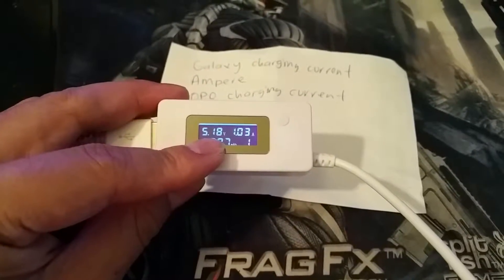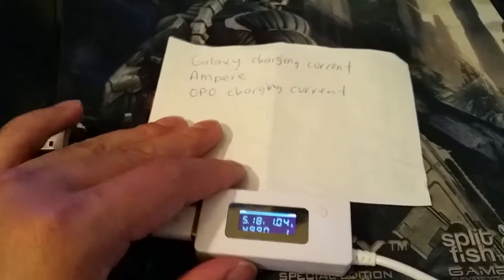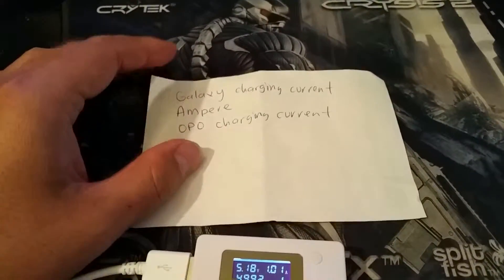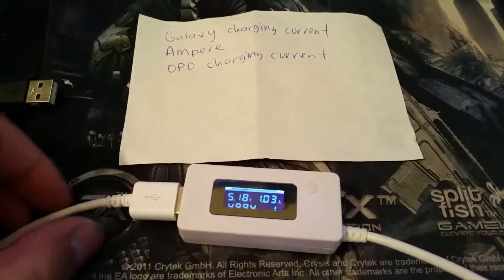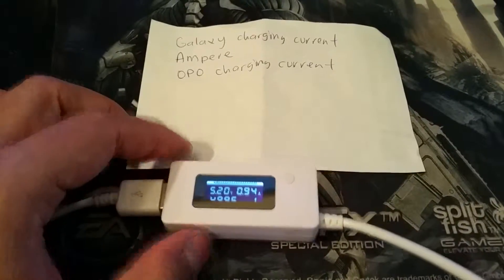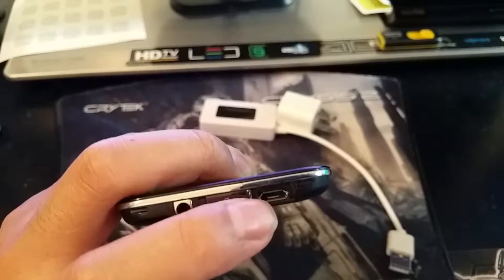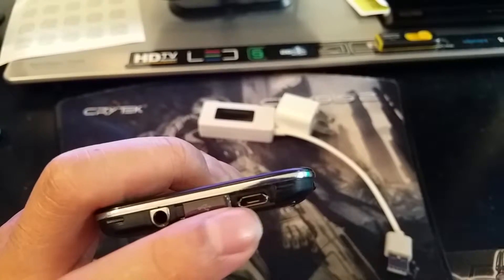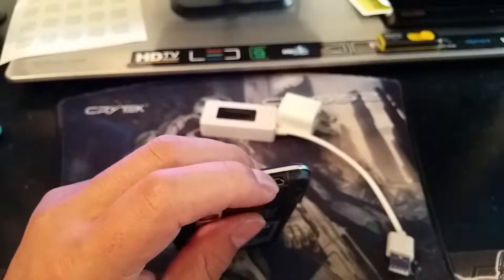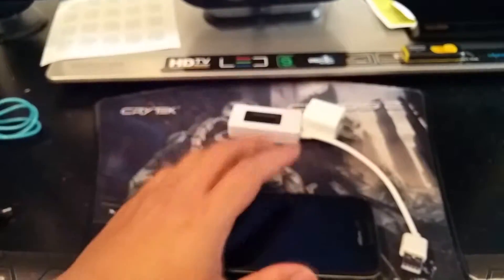It's very important to have at least 5 volts or more — if voltage is lower than 5 volts, charging will be very slow. You can also check amperage and voltage without this tool by downloading free apps from the Google Play Store, such as Galaxy Charging Current, Ampere, or Opal Charging Current. Use them as a reference — they may not be perfectly accurate, but amperage and voltage readings should be consistent. One more tip: if your phone still isn't charging, check the charging port for dirt, debris, or lint and clean it out. I highly recommend removing the battery first so a metal tweezer doesn't cause a short. If you like the video, give it a thumbs up; if you dislike it, thumbs down; and please subscribe for more videos.